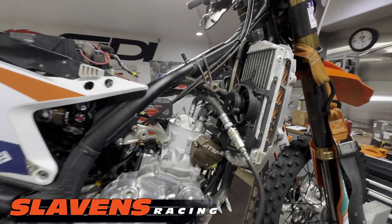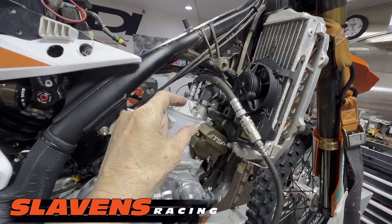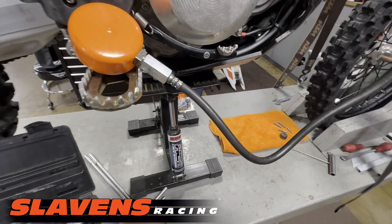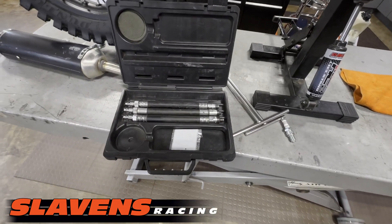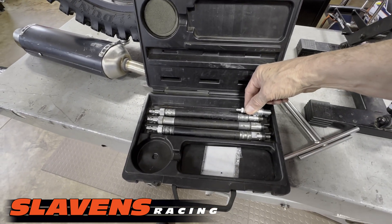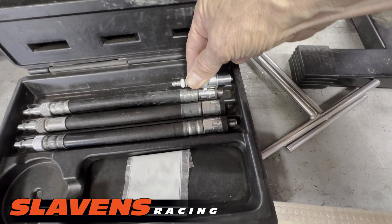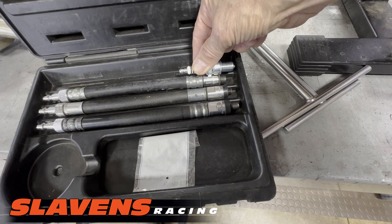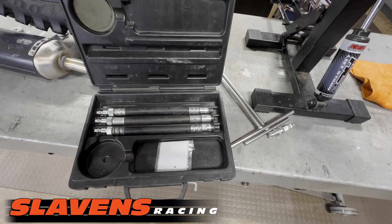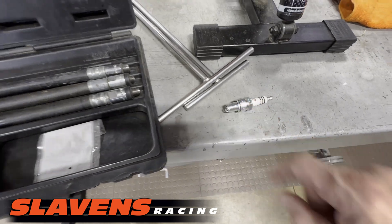You can see I've got this hose here — it's a 14 millimeter with a three-quarter inch reach thread on it, which is what the spark plug uses. My kit comes with several different ones, different diameters and different lengths. If you use one where the thread length is too short, you're going to have some additional volume in the head and it's going to give you a false reading. So you want to use one that has the three-quarter length threaded area on it.